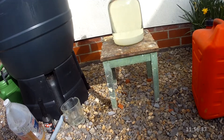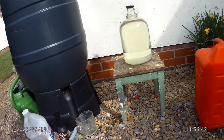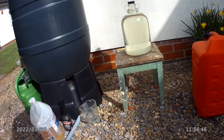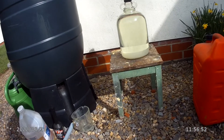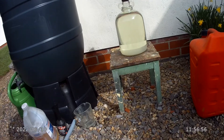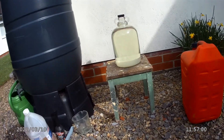Another problem with old vehicles — we all know the problems. The ethanol takes the paint off. If you've got tank liners, as I have in one of my old bikes, it will take the tank liner out and clog your carb. If you've got a fibreglass tank, ethanol will destroy it. It will destroy old paint. So there's not too much good to be said about ethanol for old vehicles.